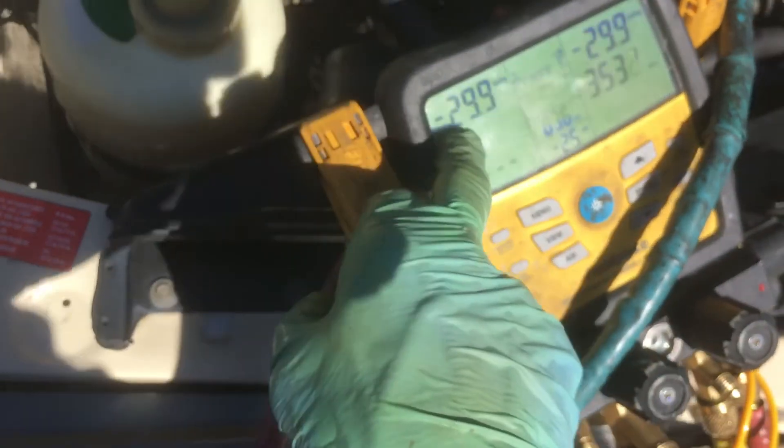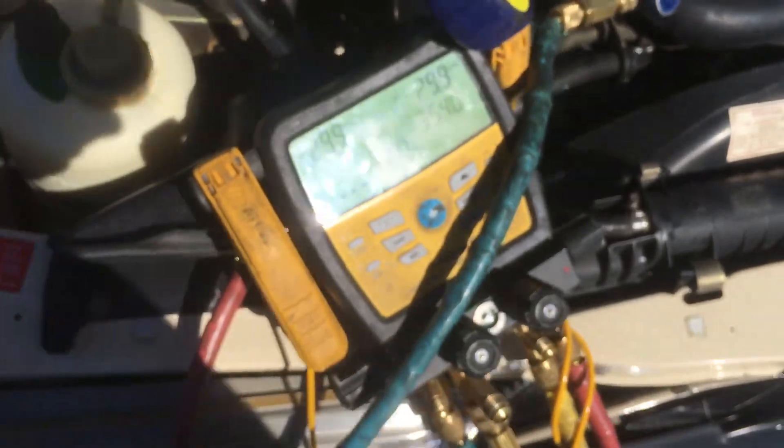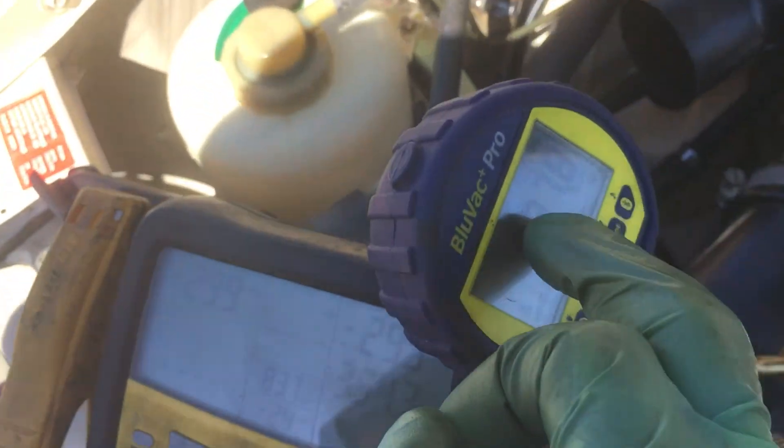So let me wrap up. I'm going to put the camera down — this is way too long and we'll get to the next video. You see I have oil contamination in my micron meter here inside. I've got to clean it out because it's not reading the microns accurately — my gauge is contaminated again. But we can still read it there.